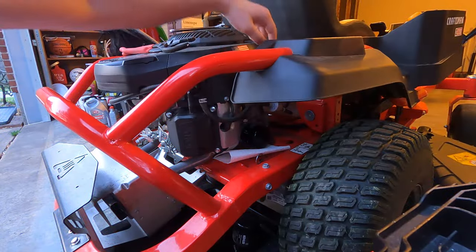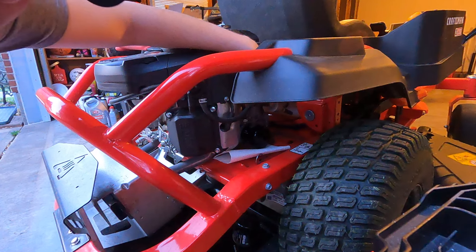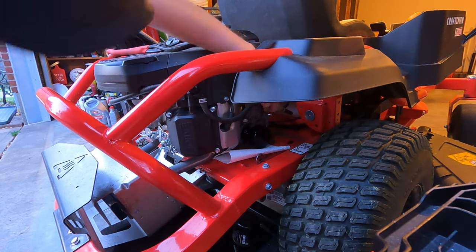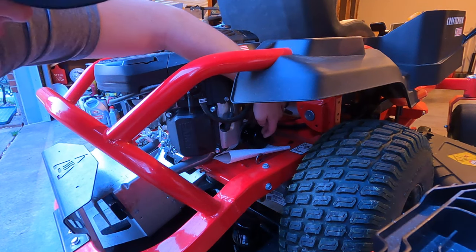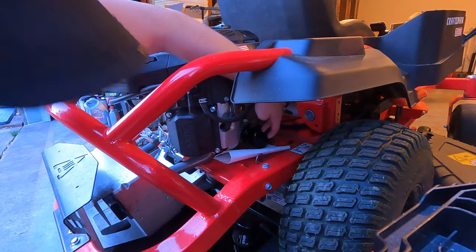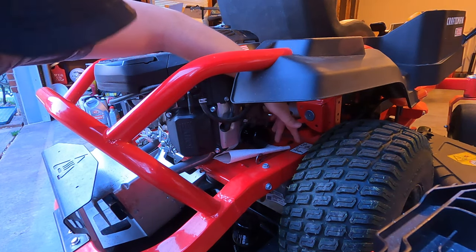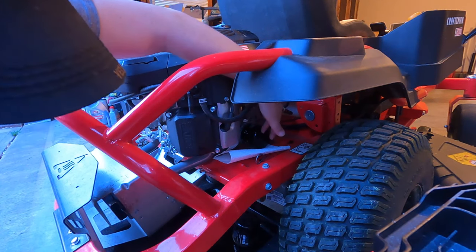You know, my dad and I have been kind of at each other's throats for the past 10 years about this, so I'm just going to say my opinion. For an oil filter, you get it as tight as you can by hand putting it on, okay? If you can get it as tight as you can by hand, I don't know, maybe 25 foot-pounds, there's no way it's coming off. You do not tighten this with a wrench.